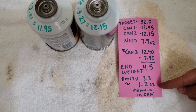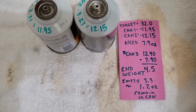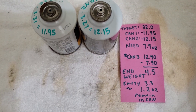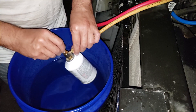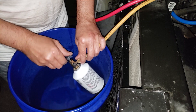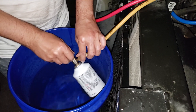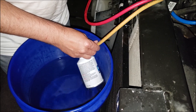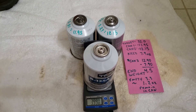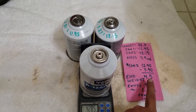The weight of the third can was 12.4 ounces, so obviously some of the refrigerant had been discharged before we purchased it. Feel free to add one extra ounce to the vehicle. I'll be adding most but not all of the contents of the third can. Since this is a self-sealing can and tap, I can remove the can from the tap and re-weigh it multiple times until it reaches the required final weight — leaving the hose attached won't allow accurate weighing. Our target weight for the last can was 4.5 ounces; it's 4.285 ounces, which is good enough.